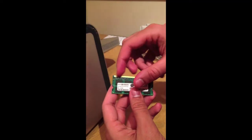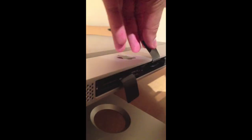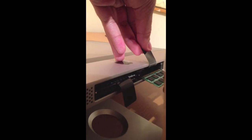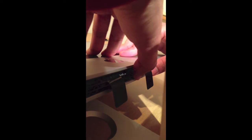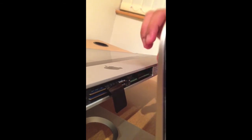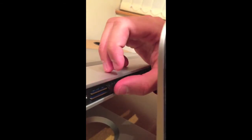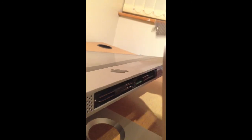Once you've got those out, you need to put the new RAM in. In my case I've got one 4GB RAM — put it in the correct way. The way you know it's inserted correctly is once you put it in, most of it should go in, and then you just need to firmly push it in with quite tough, strong pushing on either side. It should just click in and you'll hear that click. Once you've done that, tuck those levers back in as you did before when you took them out.